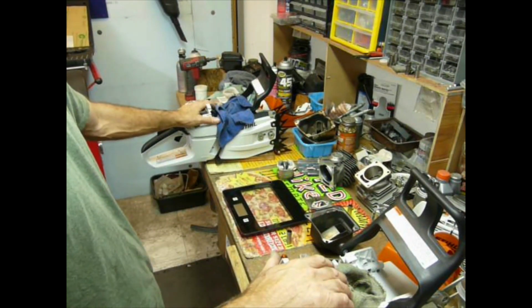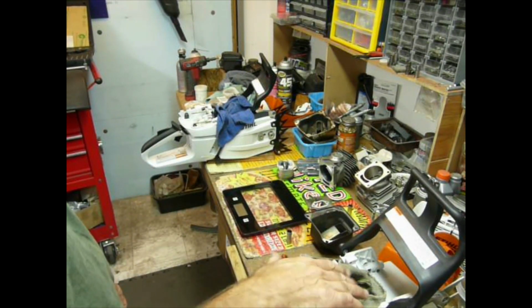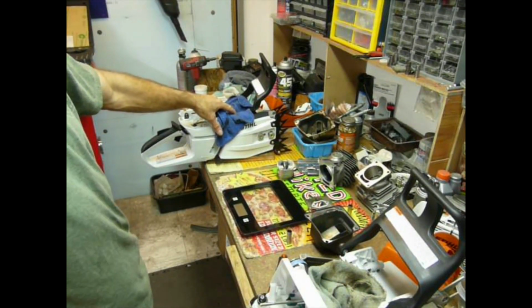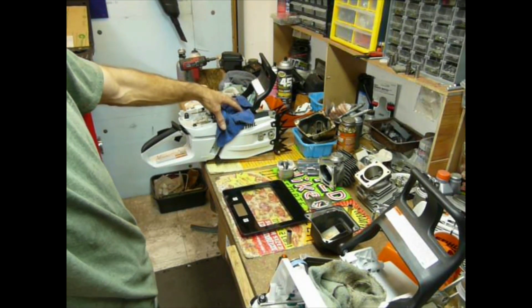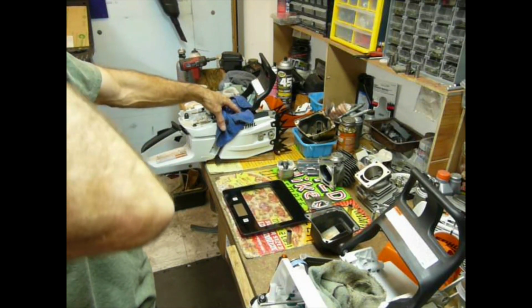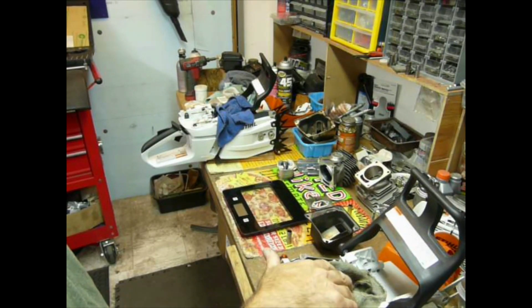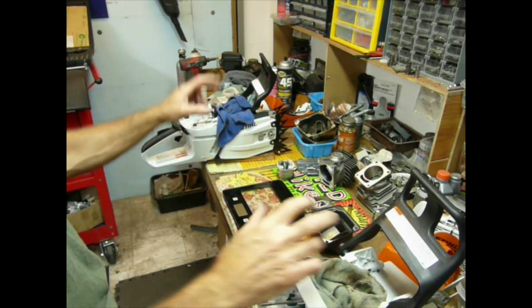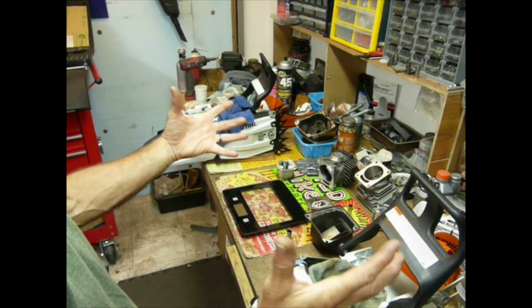6.0 horsepower, 6.0 horsepower. If you want to talk about bore and stroke for a second, the 461 has a 52 millimeter bore by a 36 millimeter stroke, which gives you 76.5 cc. The 462 has a 52 millimeter bore and a 34 millimeter stroke, and that gives you 72.2 cc. So the 461 is a little bit bigger, and they have about the same amount of horsepower. There's a reason it is the way that it is.